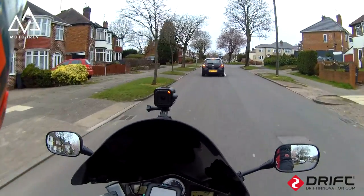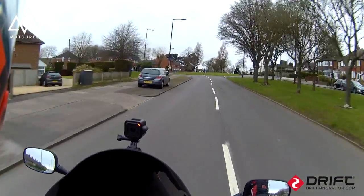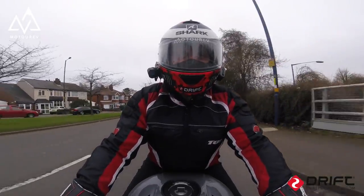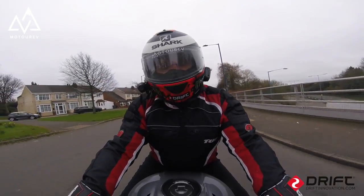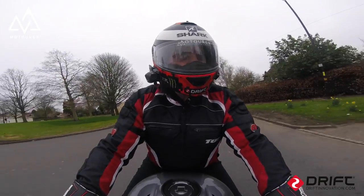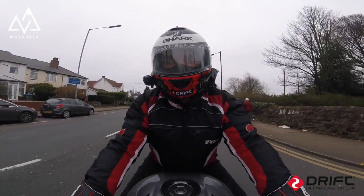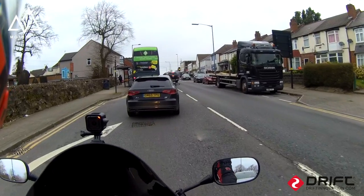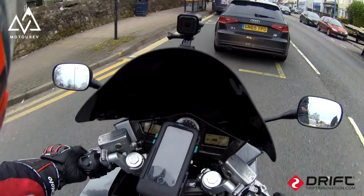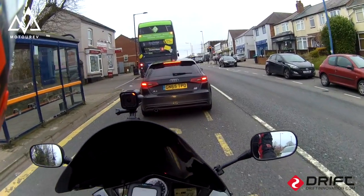I do love the sound of this bike. It feels right. Brakes feel nice and sharp. I noticed with that fork leak the front brake wasn't that good, because obviously having oil on the disc and the pad will affect your braking efficiency.